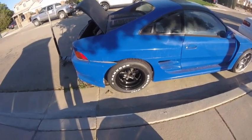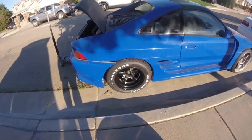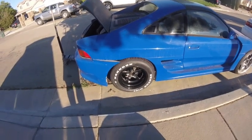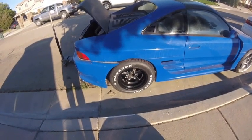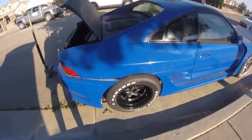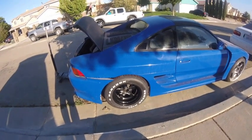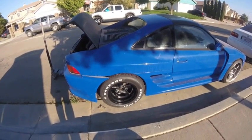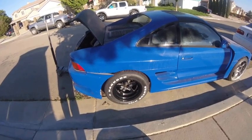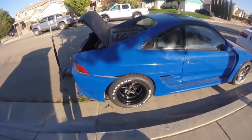What I'm going to end up doing, after I take the car to get the back bumper fixed, painted, or replaced, I'm going to take those spacers off. I'm assuming the tire will be even or just inside the rear fender. If it looks too sunken in, I may replace the 20 millimeter spacer with a 10 millimeter spacer so the wheel and tire are at least even with the rear fender.